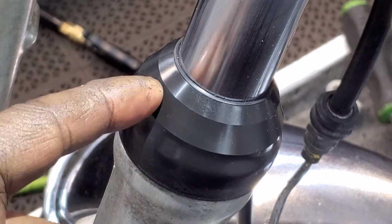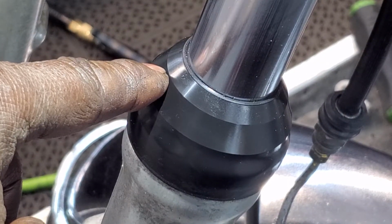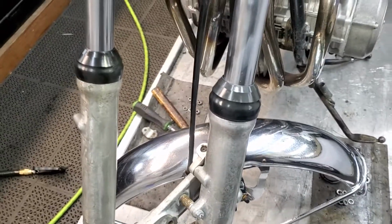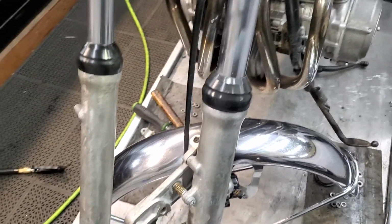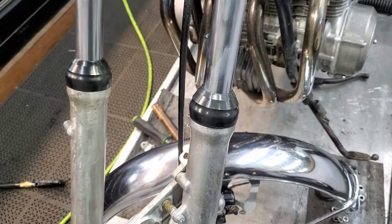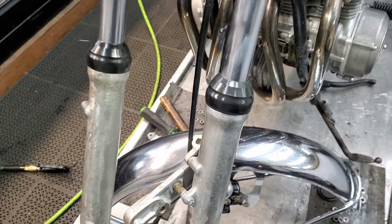And these will absolutely protect dirt from getting down inside and moving with the fork seal, basically extending the life of the fork seals themselves. So pull that out, pan back, and there's both the legs. There's some dirt rings on there just from assembly, don't panic. All of it wipes off. But yeah, there you go, man. So I'm gonna put the rest of the bike back together and put some fork oil in here, and hopefully these fork seals will last a good 40, 50,000 K, maybe even more than that. We'll see. Okay, that's it.